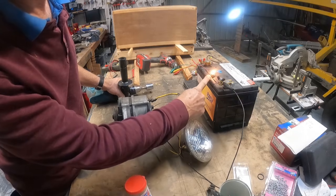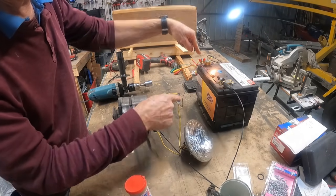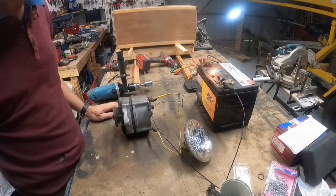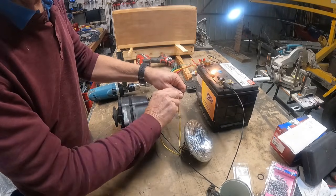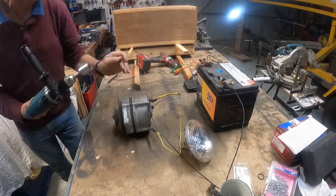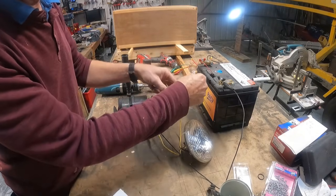Notice that the light goes out once the alternator is charging. You've got 12 volts here and nothing on the other side, and when the alternator is charging it puts 12 volts on both sides — so 12 volts either side of the light gives no voltage difference, and the light goes out. Without this light, your alternator will not charge. That light is absolutely critical to the starting of alternator charging.